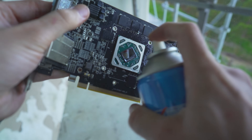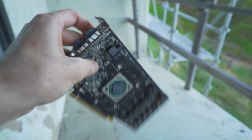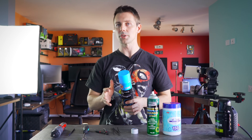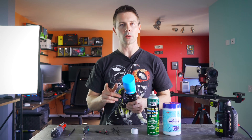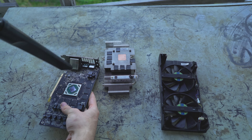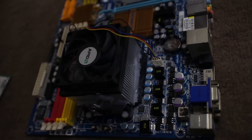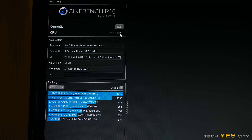I have seen people who've posted me photos where they've busted off SMDs. Once you bust those SMDs off — whether they be resistors or little caps — that component is going to be very hard to fix if you don't have good micro-soldering skills. For me, a wooden toothpick and brake cleaner is great for getting the job done and taking away any capacitive or conductive elements. You can also fix up components where someone's previously put capacitive thermal paste that slipped over the edges of, say, an AM3 CPU socket and caused the computer to stop booting. Once I've cleaned it out with brake cleaner, everything works perfectly.